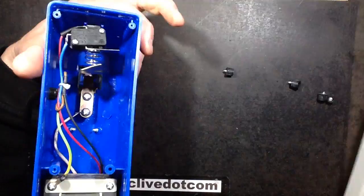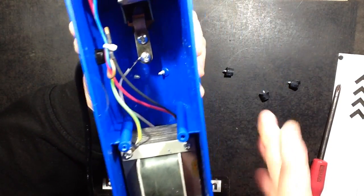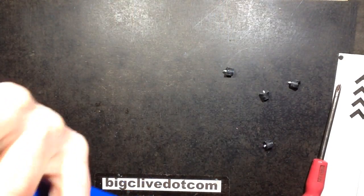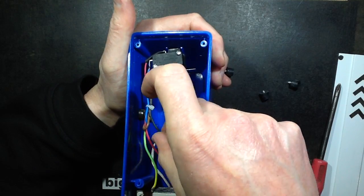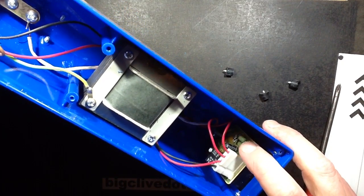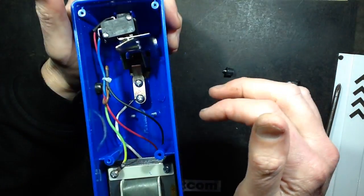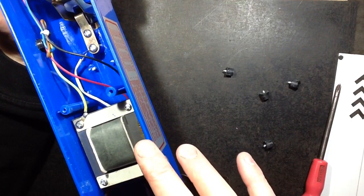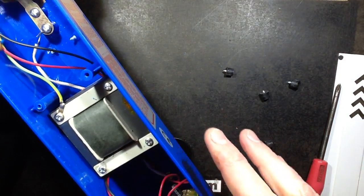The bottom is a metal plate with perforated air holes, probably to let the smoke out from the transformer. Initially I thought it could be an electronic transformer but I can hear it buzzing, so I'm guessing a wound transformer under here. Oh, that transformer is tiny — I would say that is a 50 volt-amp transformer for continuous duty. The mains come in here, live goes straight to an electronic module at this end, with some resistors which suggest a simple resistive dropper since it's only powered temporarily.